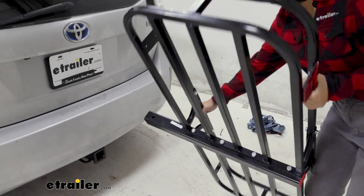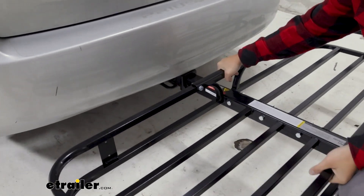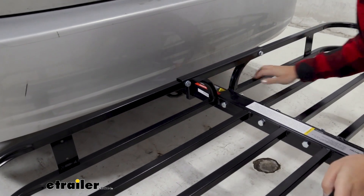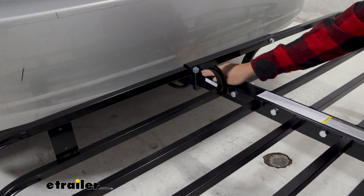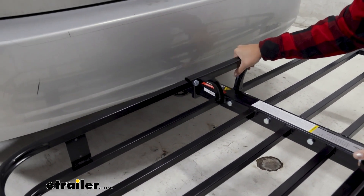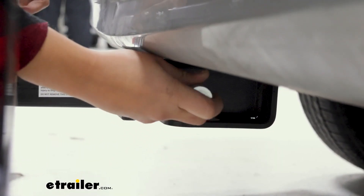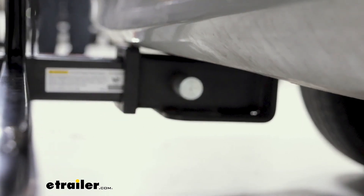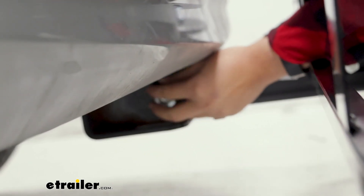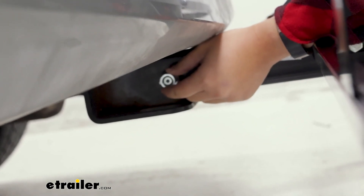This weighs about 25 pounds. When you're lifting it into your hitch, just try to get that lined up with your two-inch hitch receiver, pop that through, and then you're gonna have to figure out where that hitch pin hole is. If you want, you can get a hitch pin alignment collar so that you just set it once and you don't have to lean back and forth every time. With the holes lined up, you can then put in your hitch pin. This has a little nut that goes on the end and you can use the included wrench to tighten this down, but really it's hand-tightened most of the way.